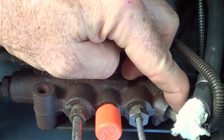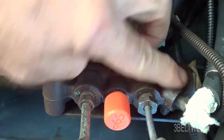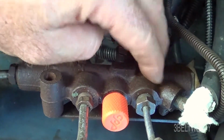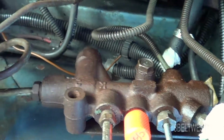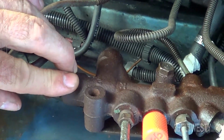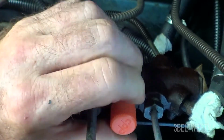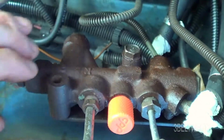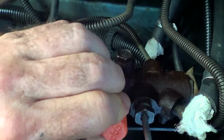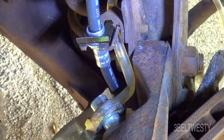And then what I had to do is open up a back line, so there's a control in the back here, and then the spool was this way to block off the front. I closed the bleeders for the front, and I opened up one on the rear here. This is the rear, and it forced the spool back when I hit the pedal pretty hard. You can look at the light, have it in the run position, and push it pretty hard till it pops back over. Sometimes it won't do that if they get crap in them. That's what I've heard. Okay, let's go ahead and do some bleeding here.